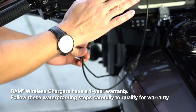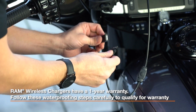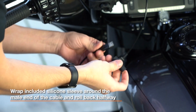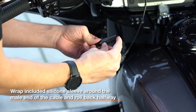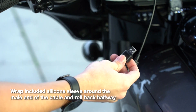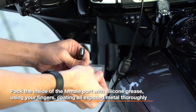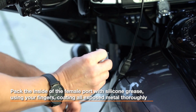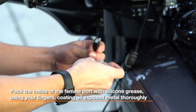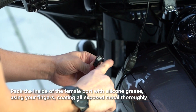When mounting your wireless charger in any outdoor or open cockpit environment, we always recommend using silicone grease on the USB connection to achieve the best waterproof solution. To do that, use the included silicone sleeve and first wrap it around the male end of the cable. Then roll the sleeve back so it can roll over the other end after the grease has been applied. Next, take the female end, which is hardwired onto the motorcycle, and apply the silicone grease to the female port — right along the outside of the port. Use any excess grease necessary and make sure you fill the port up and coat the entire outside, covering any exposed metal.